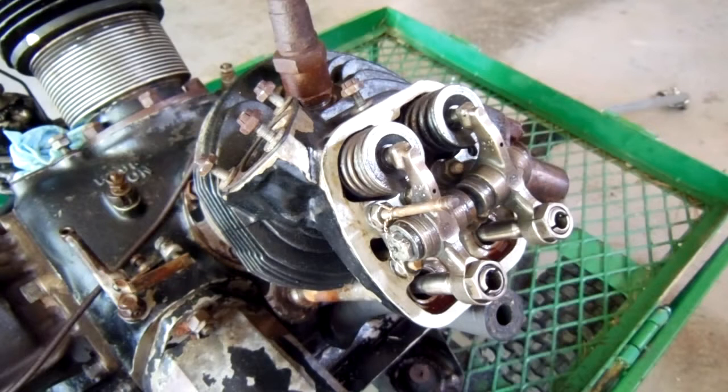The issue we're going to talk about today is valve blow-by. Now, for those of you who aren't familiar with this, very simply put, valve blow-by is a condition where a valve is not fully seating, which results in low compression in the cylinder. In severe cases, this can be caused by a burnt valve, pitting, or some other damage, but typically this is caused by carbon getting in between the valve face and the valve seat, and this prevents the valve from seating properly and forming a good seal in the combustion chamber. This is called valve blow-by because you can literally hear on the compression stroke air blowing by the valve, and this leak produces an audible whistling or wheezing type sound.